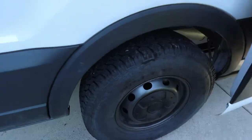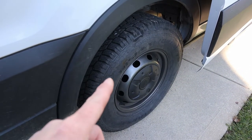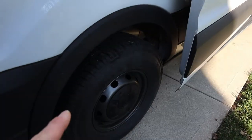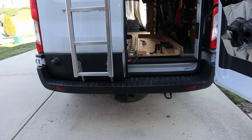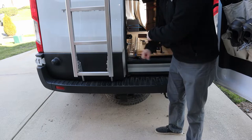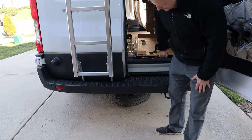The third thing is that this van has got about almost 16,000 miles on it now, so I've got to rotate the tires. That's going to be a job in itself because I'm going to have to use the spare tire to rotate through. I'm just going to do a simple front to back and back to front rotation. I want to show you the jack points under this van — not the lift points, but the jack points. First I need to get the spare down and find some level ground. I made a video about how to access this ratchet system, and since I covered the hole up I use one of these spark plug wrenches.